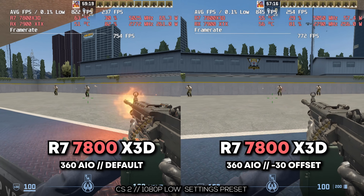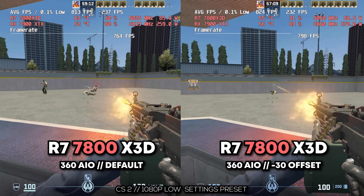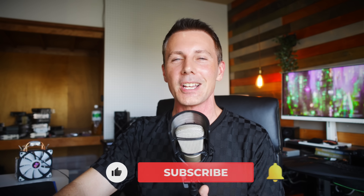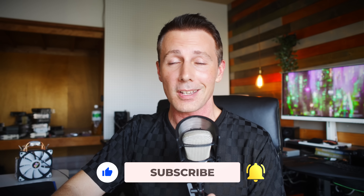I hope you found this tutorial quick, easy, and to the point. I'll put the links for Ryzen Master in the description. Also make sure you have your BIOS updated first — before my BIOS update there was a limit of minus 30, and after the update the limit extended to minus 50, so a BIOS update can help unlock new limits for X3D CPUs. And I'm sorry for the mistake in yesterday's video — hopefully it didn't ruin your life. If you have tips and tricks of your own relating to X3D chips, I'd love to read them. Catch you next time!